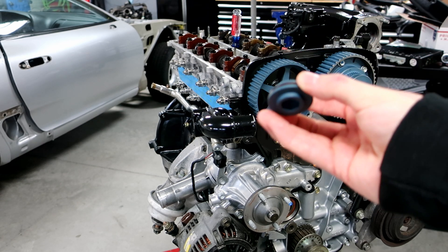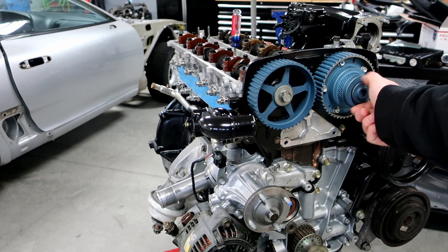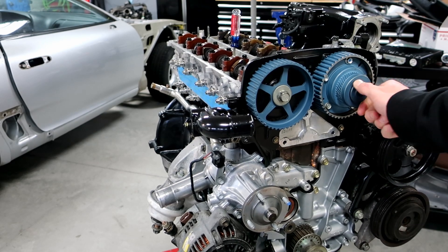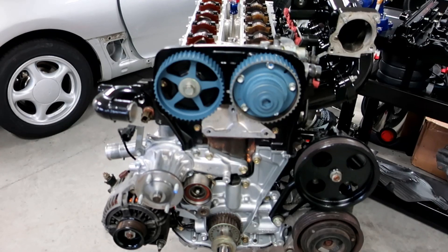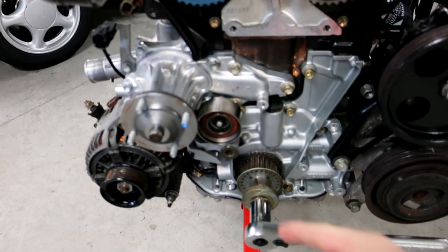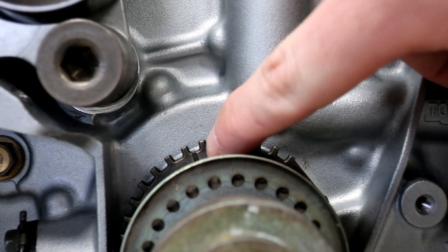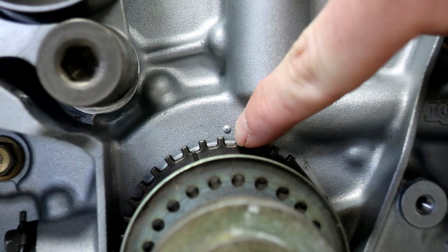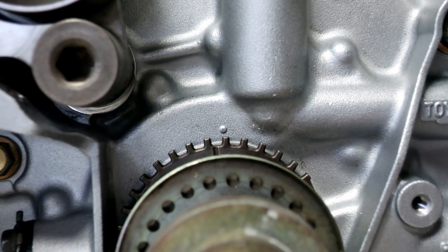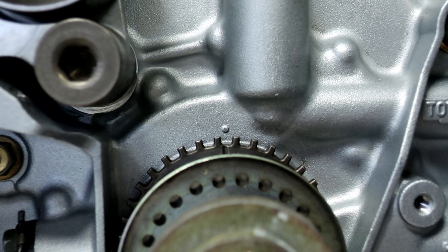I need to put this cap back on — it keeps everything encapsulated. It uses a crush washer so I'll put that on, put the 10 millimeter bolt back inside, and crank it down. Then we'll line up the marks. Starting with the crank, I've got a 22 millimeter wrench on already. You want to put your crank bolt in — you don't need to make it tight, just enough to spin the crank around. You can see a little tick mark here to get to TDC and a little mark on the crank gear itself. We want to make sure this tick mark and this dot line up. I went slightly past it so I'll go back just a little bit — right there. Both of them are lined up straight up and down from each other.